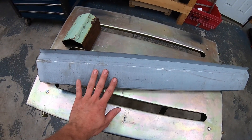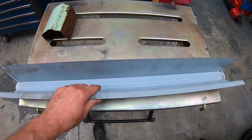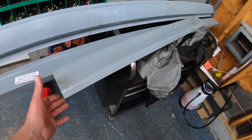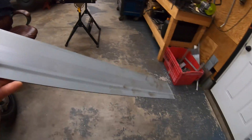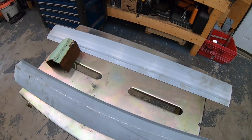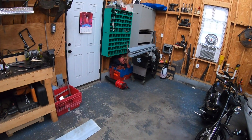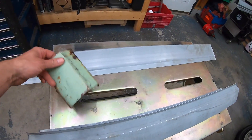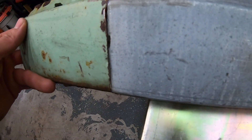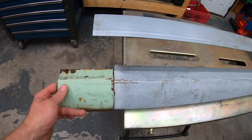So this is a piece of the new rocker panel, this is a piece of the old rocker panel, and this is sold in two separate pieces - you can see it's open on the backside. This here is the inner rocker panel piece. I got left and rights. Everything looked good; I had a piece of the old rocker cut out, and I put it up next to the new rocker, and you can see it lines up pretty good - close enough that I could make it work with a hammer and dolly and a little bit of bodywork.